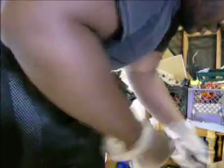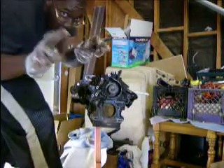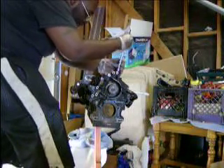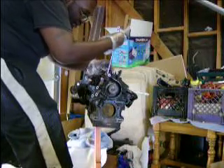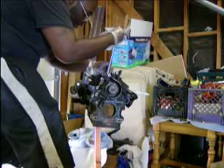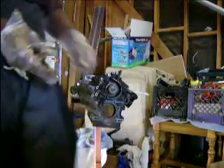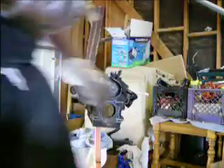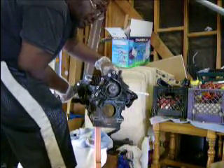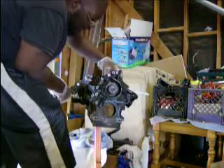Then you take your 13mm wrench — for a Ford EFI 1.9 HO — and loosen them up. There's a ridge in there; they recommend taking the ridge off. But realistically, now one thing I keep hearing about — and you guys are going to be going through this with me — is how hard it is to get these con rods off. They've been on here for a while; this car has about 135,000 miles. So we're going to see just how true that statement is.